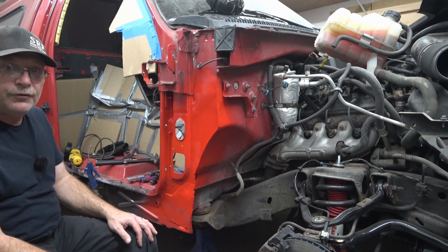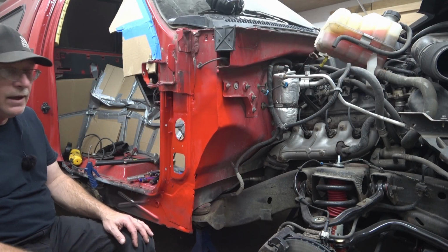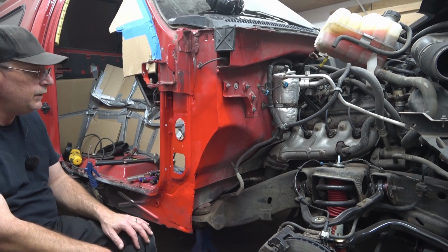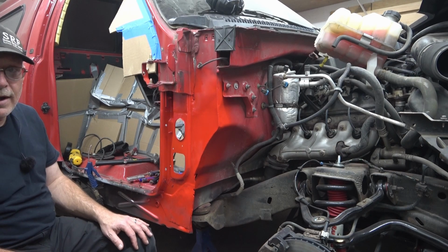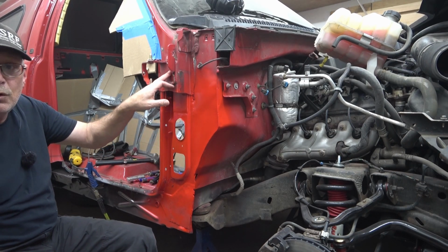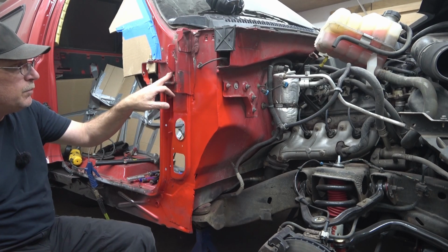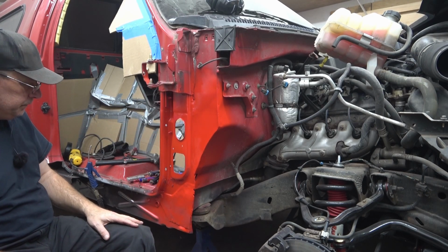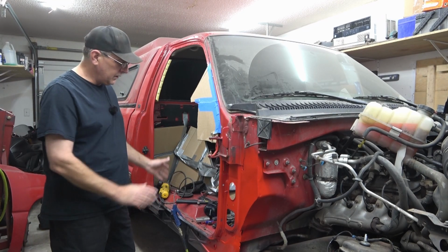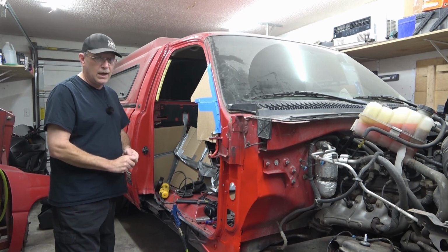Okay, so with our 2 coats of primer put on there and dried up, I've got 2 coats of nice new shiny red put on here that we'll never see again. I've got to let that dry up, and then we can start prepping the metal and remove the rest of the outer skin here of the pillar so we can install a new one. All right, so that's going to wrap it up for this part of the repair. While the paint dries, I'm going to get everything cleaned up, reorganized.